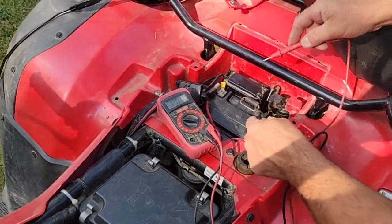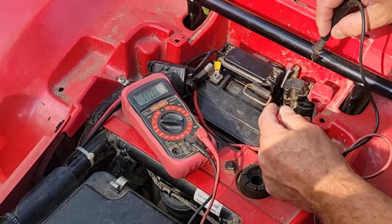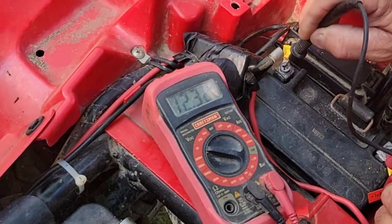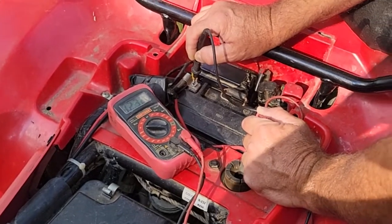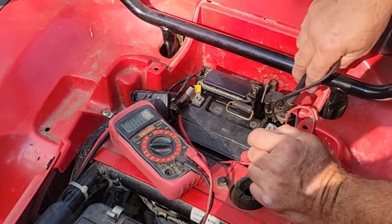This charged overnight — a 12-volt battery should be about 12.6 or a little higher. We got 12.3, which is too low. I think we have a bad battery. 12.3 charging all night is probably a bad cell in it.